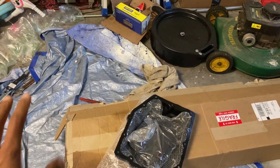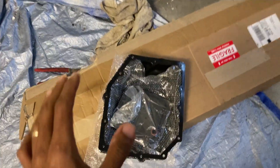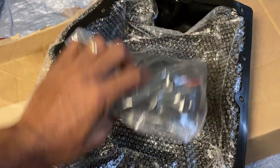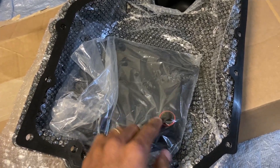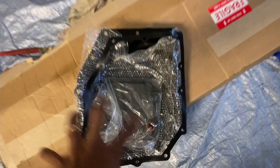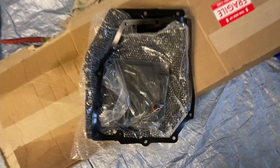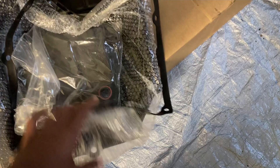If you haven't seen that, go back like three videos and you'll see the replacement on the steering rack. But here are the actual parts that came in — this is the filter for the ATF, the automatic transmission fluid filter, and it should be the correct one. This is the O-ring that you probably want to coat with some good ATF real quick. There's a bottle right here and this is the gasket, and then this is a new pan I got off eBay. I got it because it has a brand new pan since mine is getting all rusted out, and I'll see if it has a magnet inside the old one and we'll transfer it over.